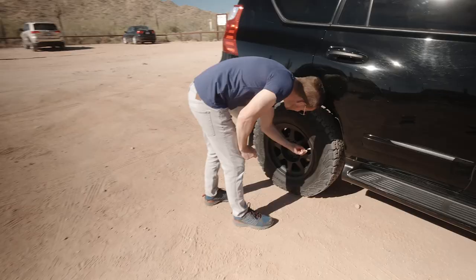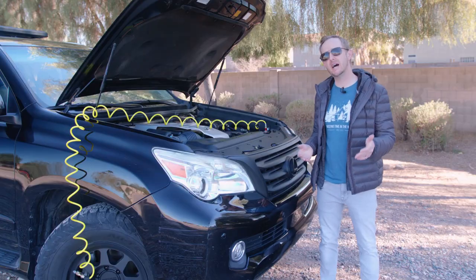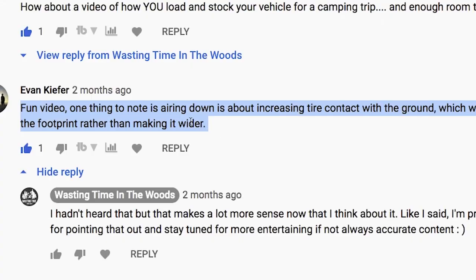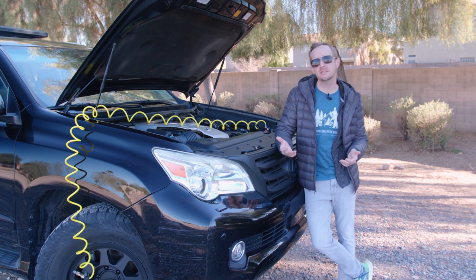In the off-road world, when you're talking about onboard air, you generally have one of two purposes in mind: air lockers or airing up tires. I'm not planning on adding air lockers — I'm just not that hardcore — but I do love airing down my tires. And when you air down your tires, you've got to get the air back in them before you hit the pavement again. In a previous video I said that airing down your tires makes the sidewall spread out for traction, but that's not really accurate. The majority of the increased traction comes from the elongation of the tread when the tire's footprint flattens out. Thank you to Evan Kiefer who left a comment straightening me out on that. Feel free to point out what I get wrong in this video in the comments below — I actually really do want to hear how I can improve. So let me know what's in your system or what you think should be in the ultimate DIY onboard air system. With that in mind, let's take a look at my system and its components.